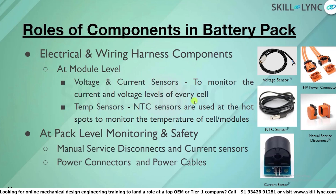We also have temperature sensors, also called NTC sensors. These NTC sensors measure the temperatures across the whole battery pack, detecting hot spots and high-temperature zones forming at the module or pack level. That information is translated to the BMS so it can take action to stop operation if temperatures are too high.